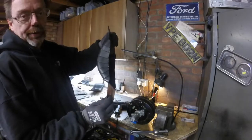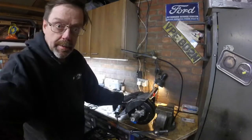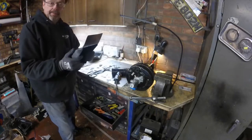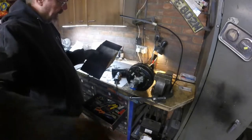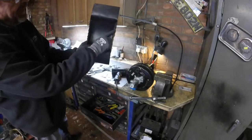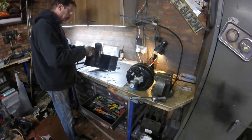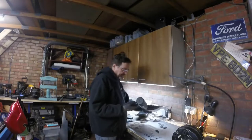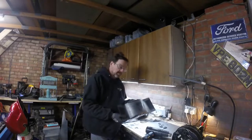My armadillo woodlouse pattern is fully overlapped and the overall bend is just right for the brake servo to go into - just right. As it cools down it goes hard. I can still manipulate the flanges while they're cooling - for example, this bit is a little bit too far in there so I'm going to bend that out a bit. I'm quite happy with that.